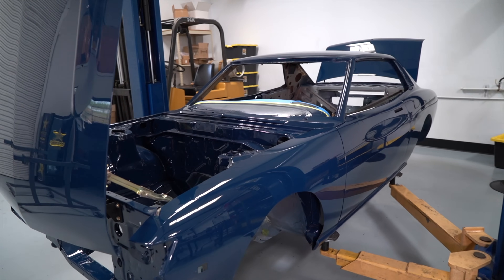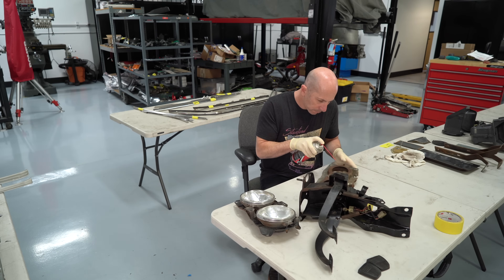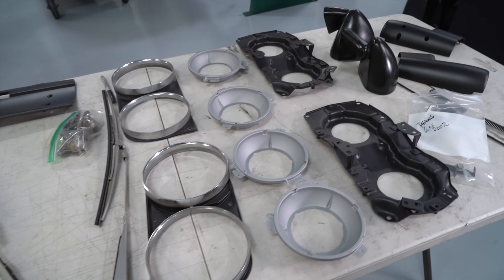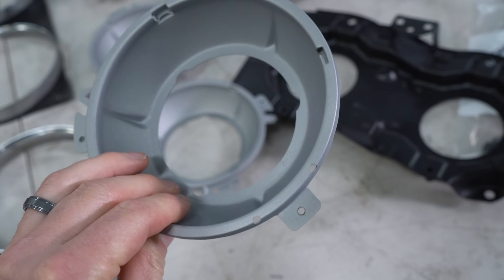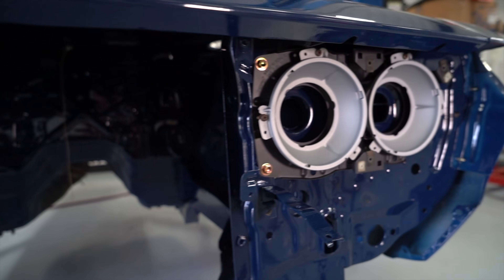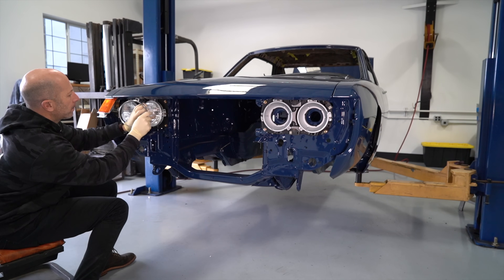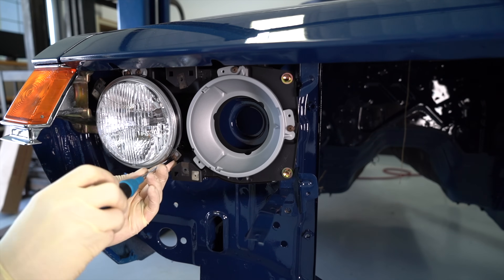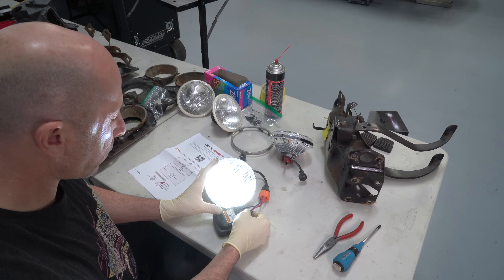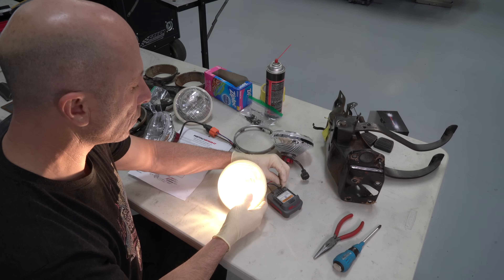Once back in the shop, it was time to reassemble. Many of the Celica parts needed to be restored — like the headlight bucket and those areas were so rusted out, so we had them blasted. The silver is actually Cerakoted, and the whole back piece is powder coated. Some of the pieces we used SEM trim black paint, which is an amazing paint with a really OEM-looking finish. The headlights are a Holley product — it's actually an LED headlight but it has the retro look to it still. I think they call it Retrobright. I'll leave a link to those in the description. The modern LEDs are so much better than the old halogens, but these are neat because they still have the old school headlight look.